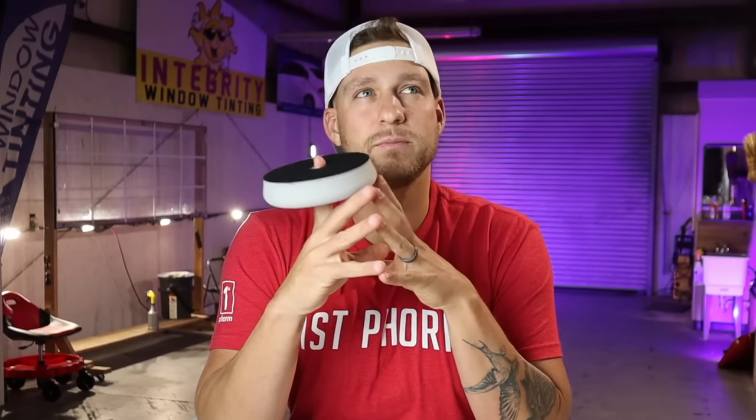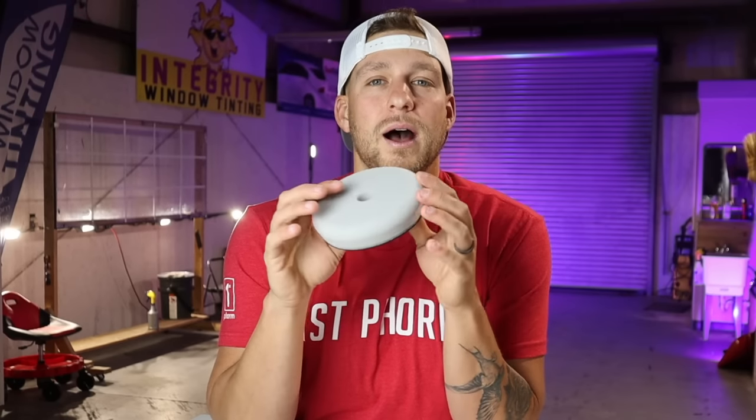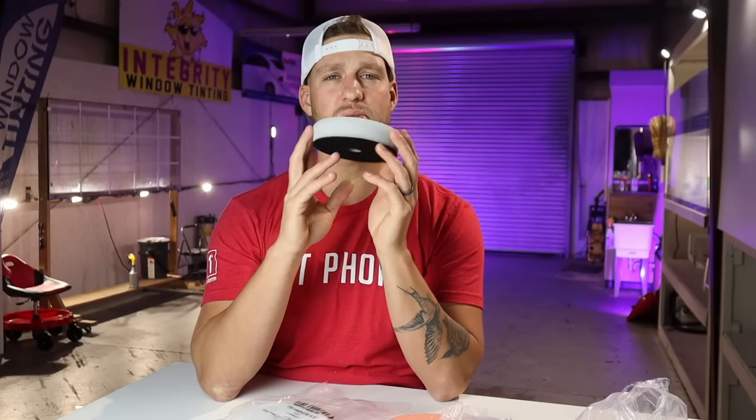This pad is gonna be specifically for when a customer has very, very light oxidation, or maybe your boat has very, very light oxidation, and you're wanting to compound that out and polish in the same step. Okay, this is gonna be a very good pad because it's gonna cut pretty good. It's not gonna cut nearly as good as the wool pad, but it will cut pretty good, and it's going to leave a nice finish. So you're not gonna have holograms and swirls or anything like that when you use this pad on a DA or a force rotation.